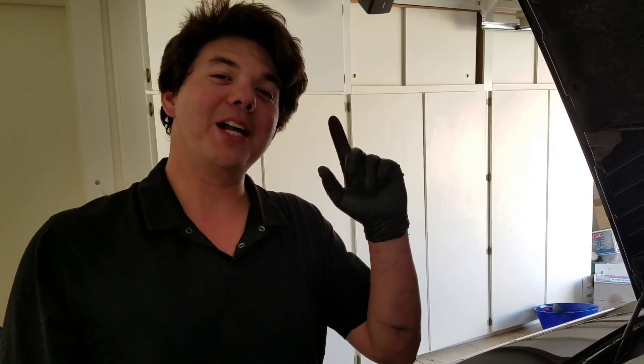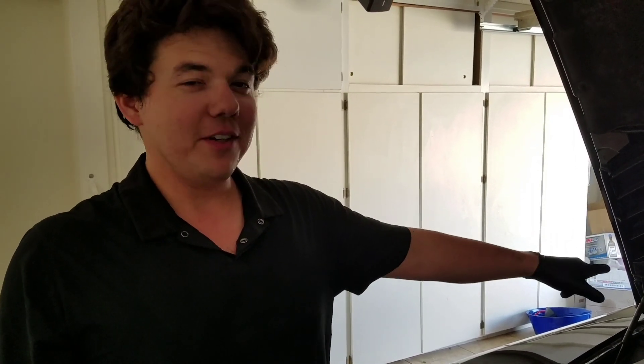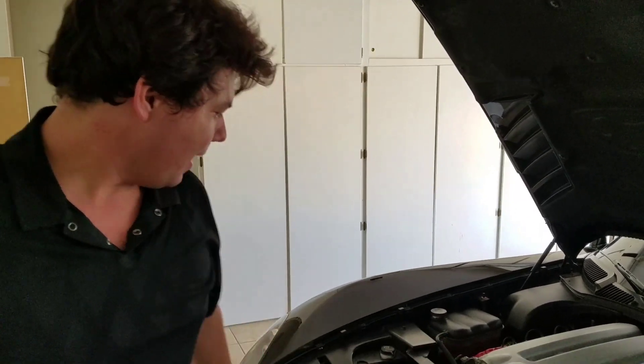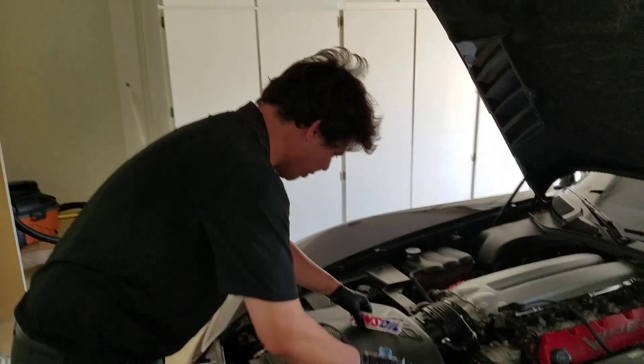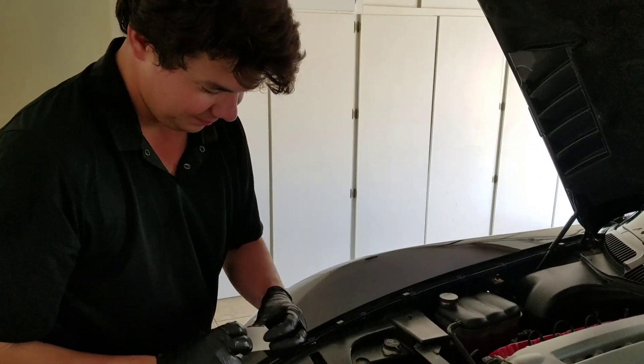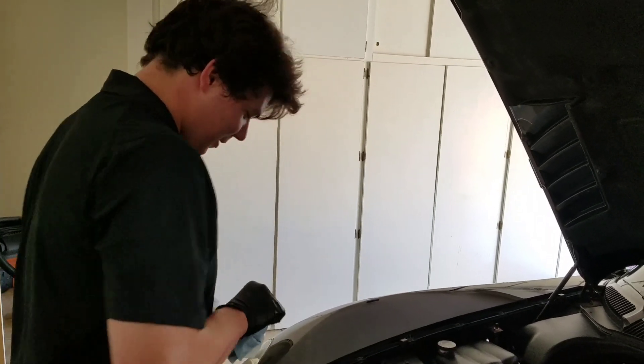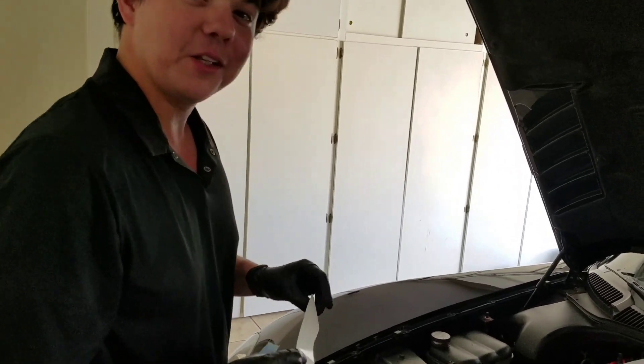It's that time to put on our badge of honor. We've done our 75W90 transaxle manual transmission gear lube, which has friction modifiers so when you shift your transmission it shifts smooth, and also has the modifiers in it for differentials. We did our rear diff with 75W140 — it's a very thick honey-like gear oil and a high-pressure lubricant for extreme track driving, which this car is made for. American Viper with American-made 100% synthetic lubrication.